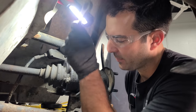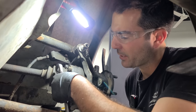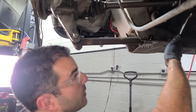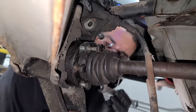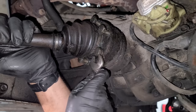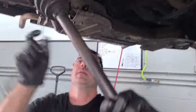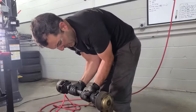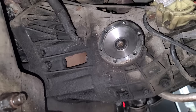Imagine about a half hour of this — actually it gets loose, maybe 25 minutes. This is where you just kind of blank out and go to your happy place. My happy place is working on an old DeLorean. Before I remove all of these, I have to leave one in so I can hold the hub, hold the axle, and then loosen these guys up. Axle boot on the other side is torn, this one's torn too. Axle number one is out — you can definitely use this for close-hand curls. I can't wait to see what the dry ice blast machine will do to this transmission.